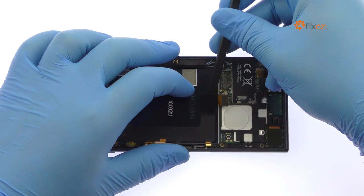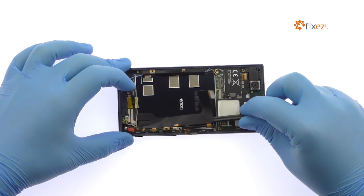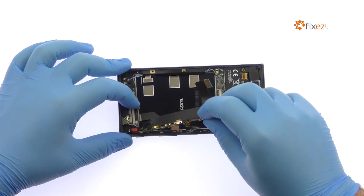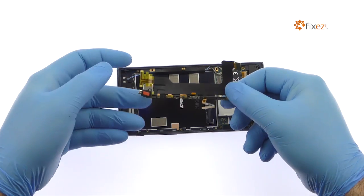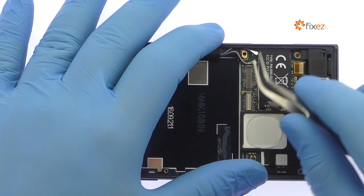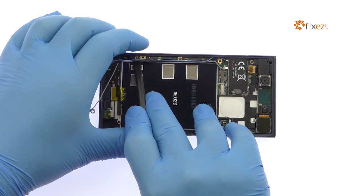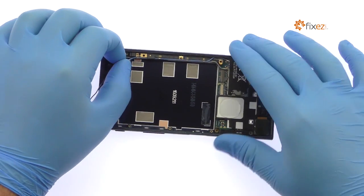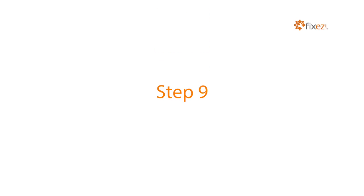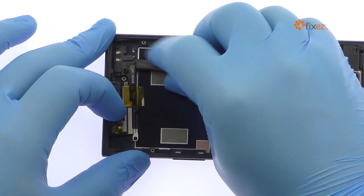Pry up the cable from the Sony Xperia XZ motherboard. Extricate the cable array that includes the vibrator and power, volume, and shutter release switches. Easily remove the plastic bracket from the side — it includes two coaxial signal cables and an antenna. Use the spudger to pry the Sony Xperia XZ loudspeaker and antenna module up and out of the metal rear enclosure.